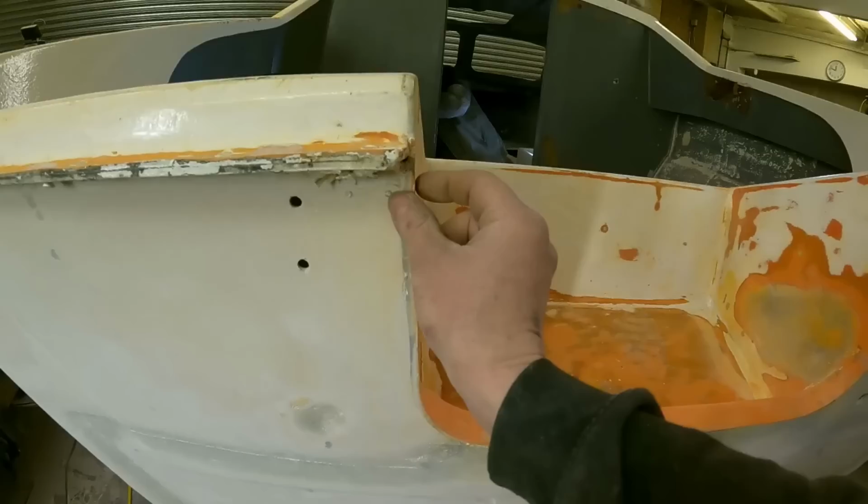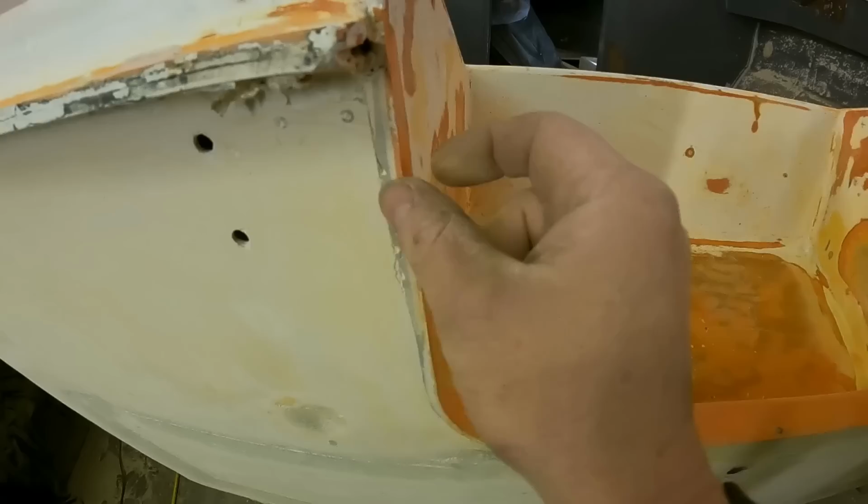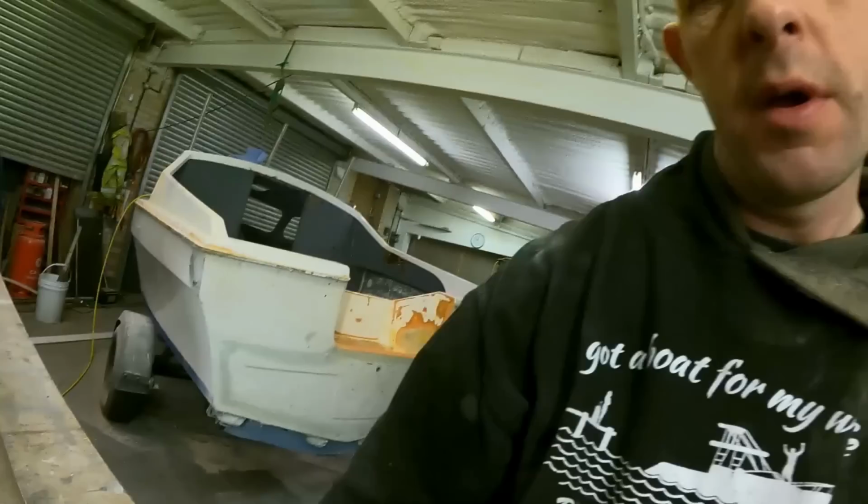So, I've done some sanding now, so pretty smooth, ready for some filler. But before I fill it, what I was thinking is, around these edges here, this is potentially going to show fault lines, isn't it? Originally I had this rubbishy piece of aluminium which went round, but that's obviously off of the 80s. So what I'm going to do is make a stainless steel strip that goes all the way round here. Then it's going to lip just enough to cover this edge. I've actually got some scrap 316 stainless with a 90 degree in it. So if I cut it off along there, we'll see if we can make it bend round, and then it'll look beautiful, won't it? Obviously we won't fit it now, we'll fit it after it's painted, but the reason I'm doing it now is so we don't damage it, because we need to do a bit of hammering. So before we fill and paint, we can give it a good hit, can't we?